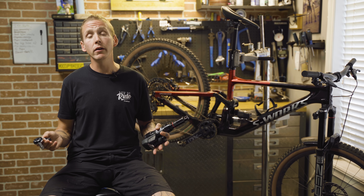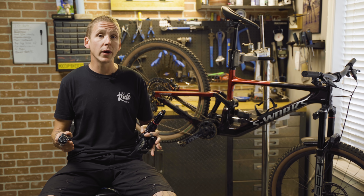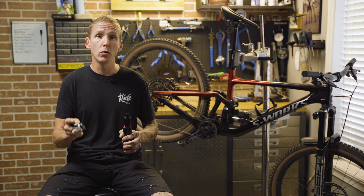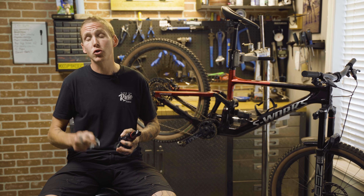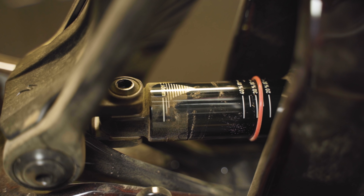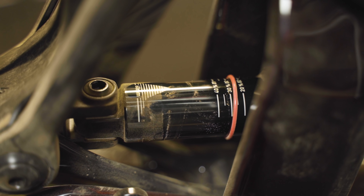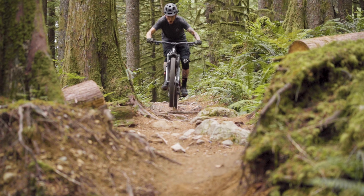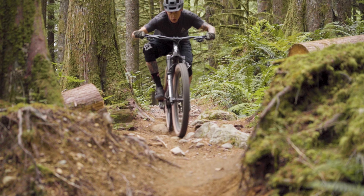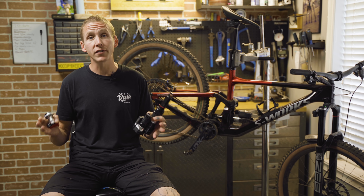The whole idea here is to turn your sluggish enduro bike into an efficient pedaling machine, and to do it in an unobtrusive way that doesn't involve you flipping a switch and that feels natural on the trail. That's why the system always defaults to full open when running in auto mode, unlike Live Valve. But when you come around a corner and there's a steep uphill to grunt over on your enduro bike, that's when Flight Attendant dials up the compression damping, which dials up the efficiency.